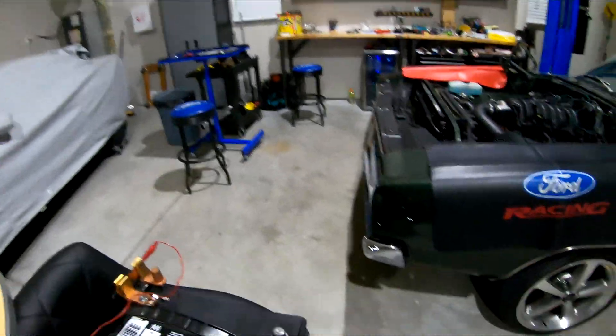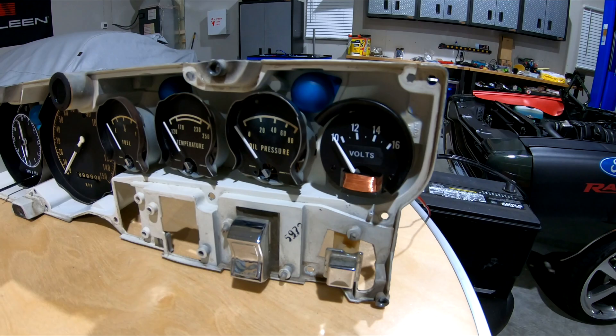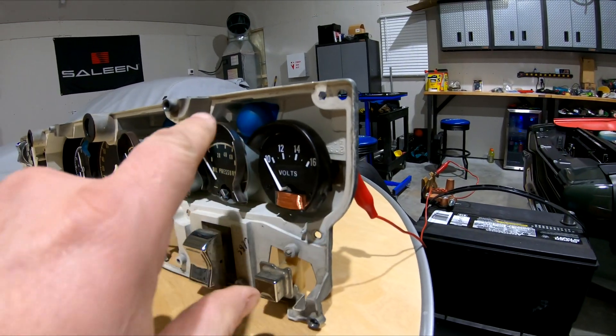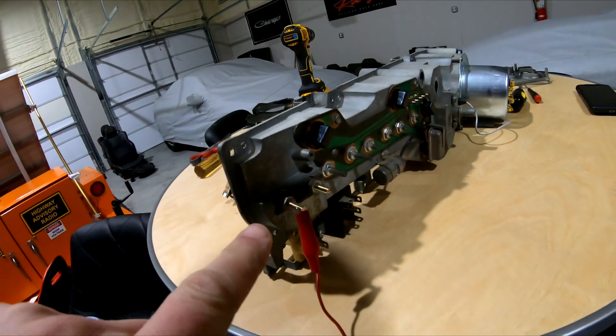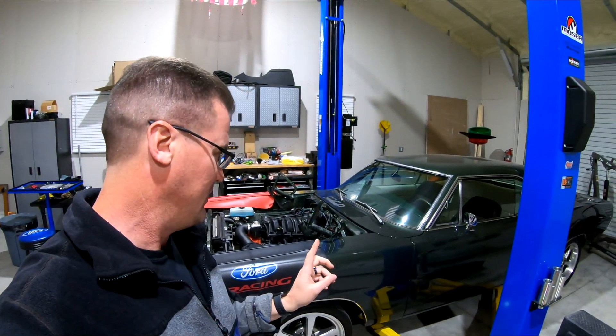This gives you an idea of how to wire in the volt gauge. I made a 'Volt' sticker with my label maker. The key point: if you don't isolate the gauge from the metal cluster backing, you'll have a dead short — hook it up and the gauge won't work, and if you leave it on too long it'll melt your wires. Make sure you isolate it, then you're good to go. Put the bezel and everything back on and get it ready to go back in the '68 Charger.